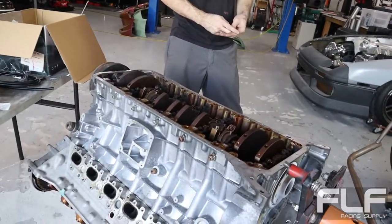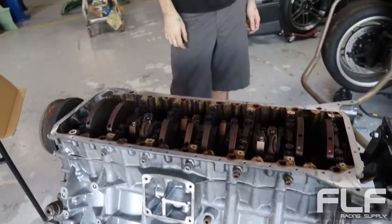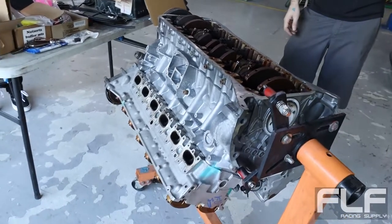Weight-wise, being that it's a V12 versus the pushrod V8 - you had an iron block LS? Iron block. So switching here, the weight penalty might not be that much, especially since you're eliminating the turbos and intercoolers. I had a 90mm turbo on the front of the LS - pretty big turbo, like 50 pounds on its own. So actually when we roughly calculated it, the weight of the LQ9 iron block and the turbo system is pretty much the identical weight as the V12. It's a massive motor, fills up the bay, but I'll be right around the same weight as before.